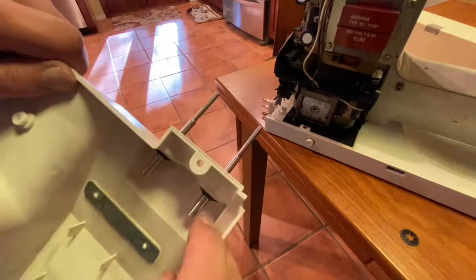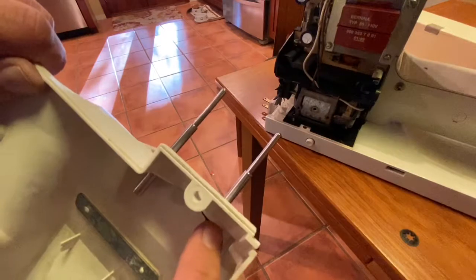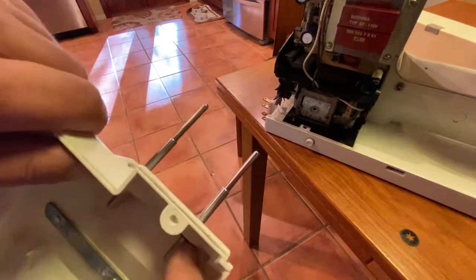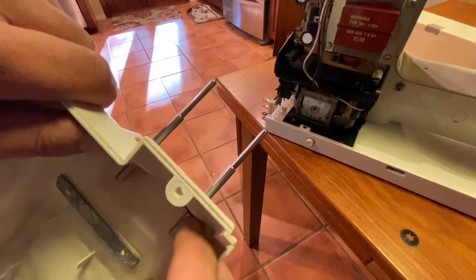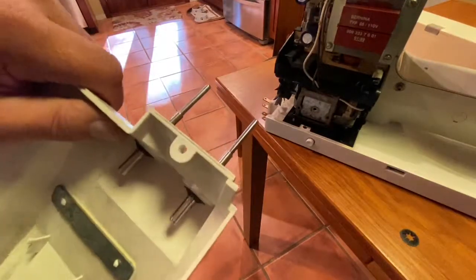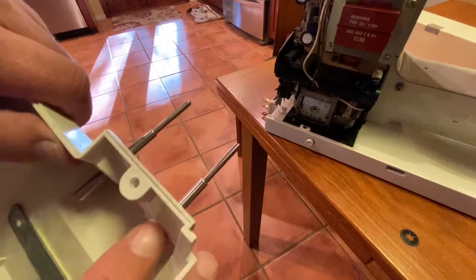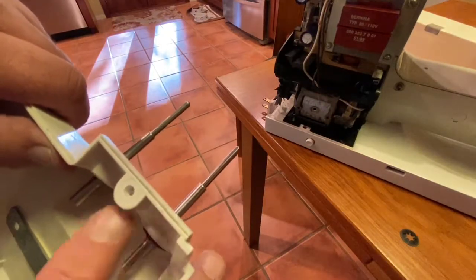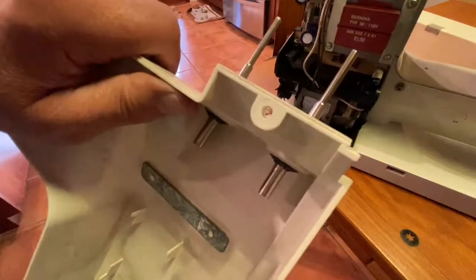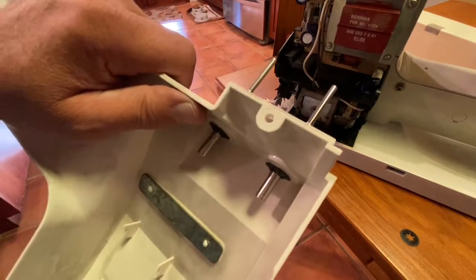The key to removing it is patience. Just use that gasket scraper chisel bit — get the sharp point in and slowly work it — then spin it with the flat-bladed screwdriver like I showed you, and you will be able to get it to move and come off without breaking the plastic. That's what you're trying to avoid. I'm just doing this for people who have a busted pin and want to get it replaced.